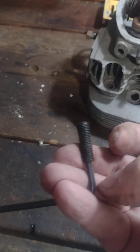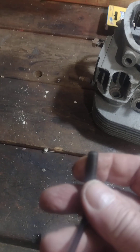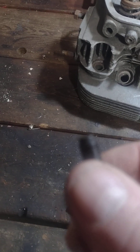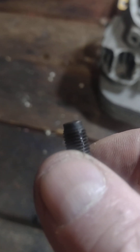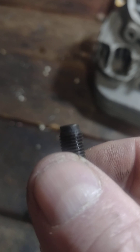So I came up with the idea. I found some 8 millimeter by 25 millimeter long, one pitch grub screws. They're hardened steel. They don't have the fancy taper like the factory ones do. Somebody told me — I went on the Run Volkswagen page on Facebook — all these are convex and rounded on the tip. Well, that's as flat as a pancake, that's not rounded.